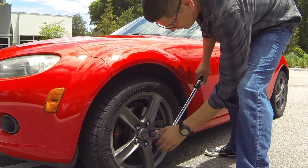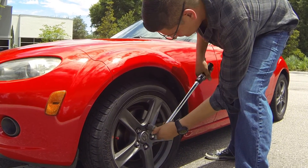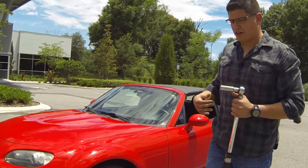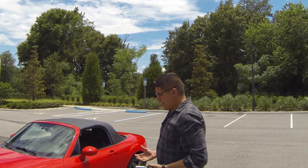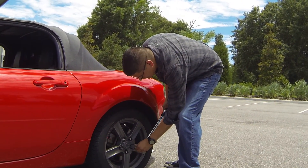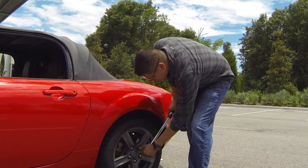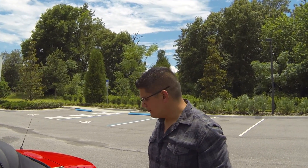Go to the next one and it's done. Many people have different procedures — you drive it for a couple of miles, come back, and re-torque to make sure nothing has shifted. You can also go around and verify your lug nuts are torqued. Checking them this way won't confirm exact torque, but since I recently removed and re-torqued these wheels, I know they're at the correct 75 foot-pounds.